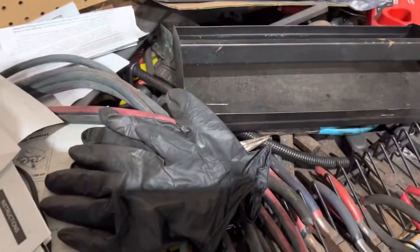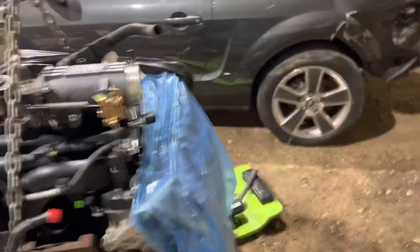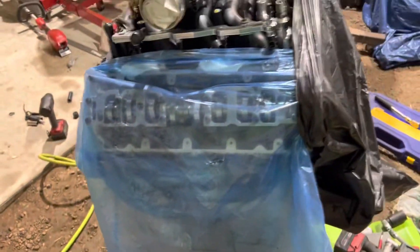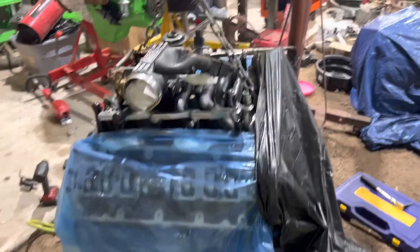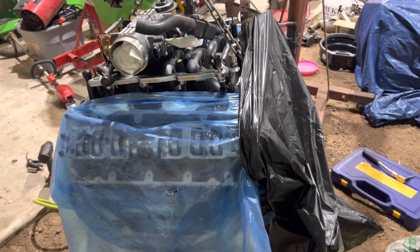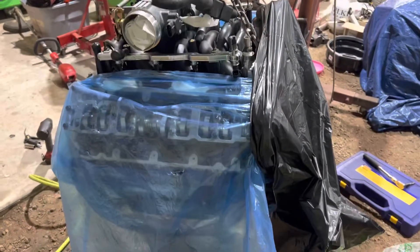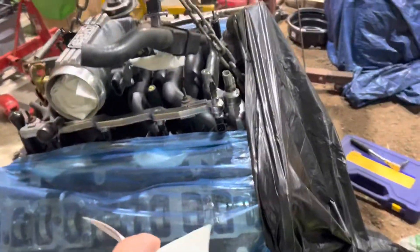The point of the video is these are Competition Cams stage four cams, and I have really bad piston-to-valve contact. I did not degree the cams — yes, you should. I need to order a degree wheel and degree these because they will hit pistons on both sides. On the driver's side, number six intake and exhaust were hitting. I took it back out, rotated fine, kept going, and then number one exhaust was hitting as well — right at max valve lift.